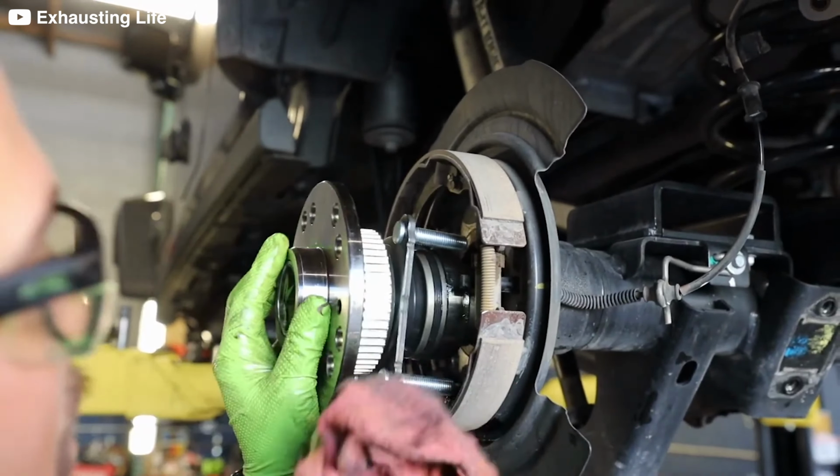Now, of course, here in the Northridge 4x4 do-it-yourself garage, well, they don't call me Tech Tim for nothing. We're going to show you an even easier way to do that. And that's with a stud installer tool. This cool tool takes the stack of washers idea and it incorporates a bearing to help eliminate friction. And that's going to allow a smoother pull on the stud. Now, we got ours from that Mega Corp online and paid less than 20 bucks delivered to our door.